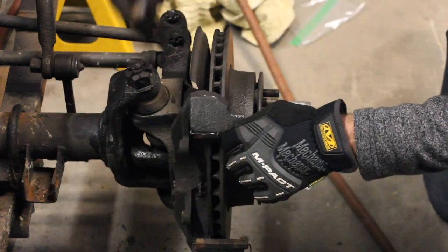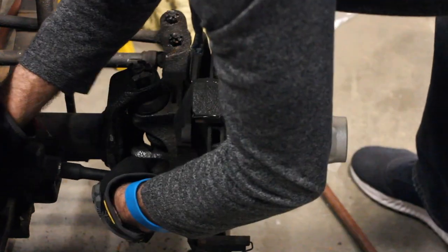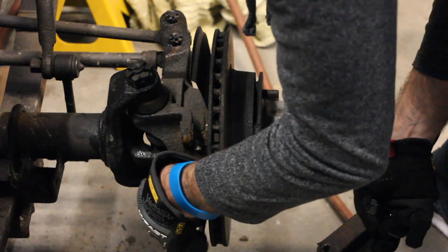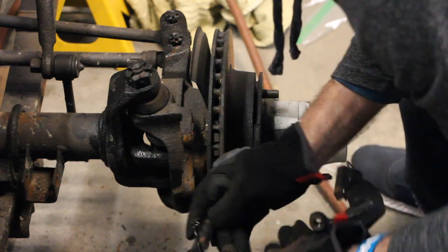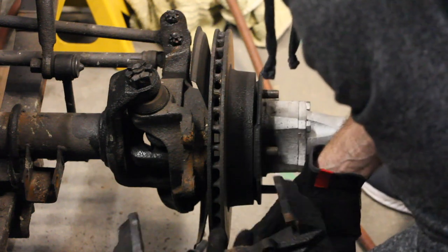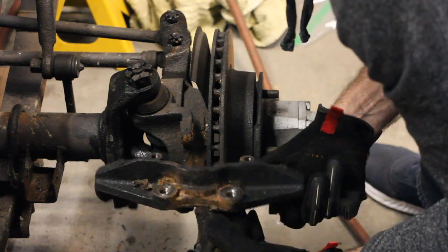Now that we've got this, we're starting to get this closer to being loosened up. We just need to take off this bolt — the angle doesn't work really well with the axle, unfortunately. Two main holding bolts and then your whole bracket comes off. Look at that — we've got small creatures living in here. There's your caliper support bracket and the two little wire springs that hold the anti-rattle clips for the brake pads. That will come with the new one — I don't know if this comes with the caliper, but if it doesn't, then I will have to refurbish this.